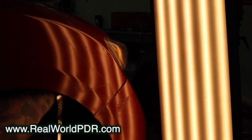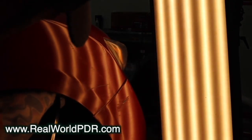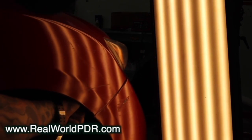Same tools, same techniques — I just switched the camera angle a little bit. I'm using that rolling technique and that dragging technique right up where that body line is. I am not a stand liner salesman — I'm not associated with stand liner, I've never gone to Lithuania to train. I just love the tools. I make zero dollars talking about them. Using that dragging technique, you can really see how I've shallowed up that area without putting any texture or push marks in there whatsoever. To reestablish that body line, that rolling technique works well. Now I'm going to a slow bend pirate hook to get the majority of this body line out. I've also switched to the bottom of that fender close to the bumper, using that same dragging technique.